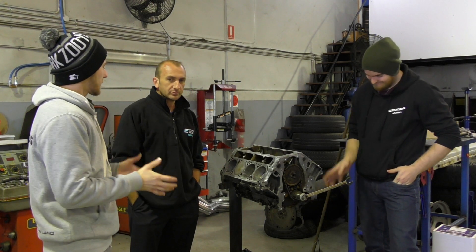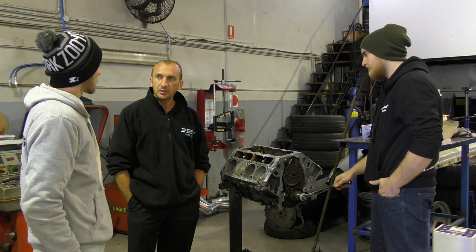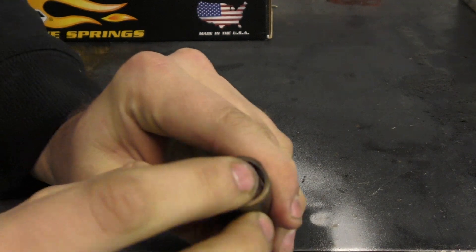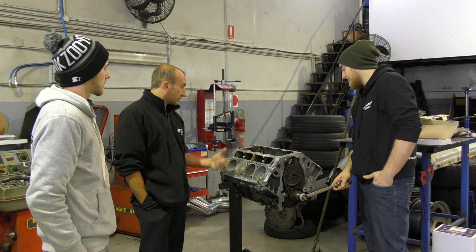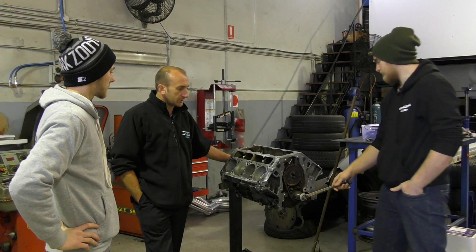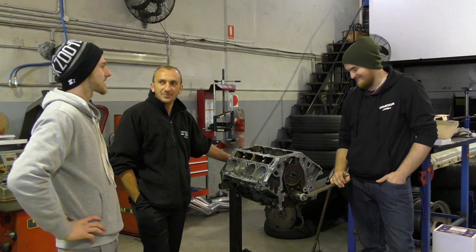But what did you find from the car? Not much — we sort of pulled it apart, it wasn't a great deal. It was really just a couple of lifters that got a little bit seized up and locked up. It'll get noisy. It's very clean right to the front — too smooth for a motor with the amount of k's it had on it, it looks pretty healthy on the inside. It was really clean on the inside — nice slides, the cap was clean, the sump was clean, even through the valves and stuff. So we're happy to stack this back together with new gaskets and all your little bits and pieces. Excellent, we'll get started on that.